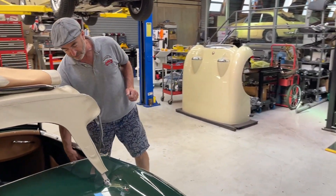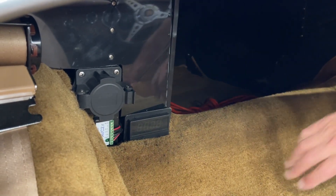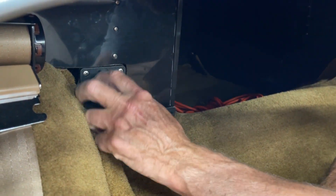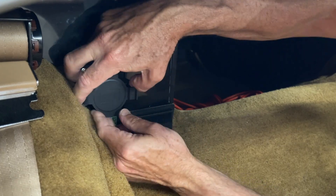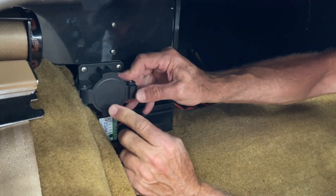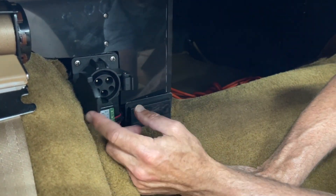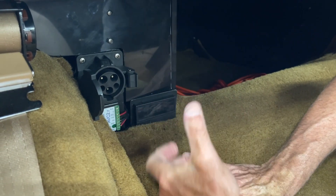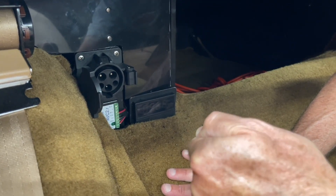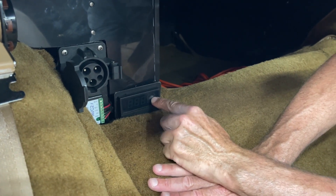If you have less time or if you have a 30 amp charger at home you come back here — and I'll jump on the other side to show you. This 220 outlet is right behind here and this flips open. So this has this little catch. This is how you open it, and then you have the little gun for the charger. You hold the button in, push it in, let go. You hear it click and this lights up and will tell you the voltage.